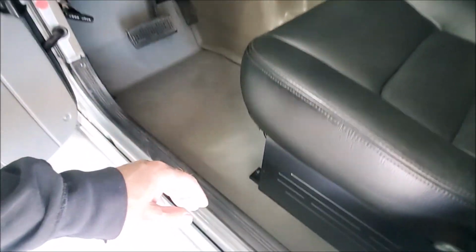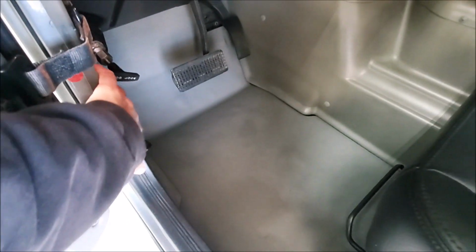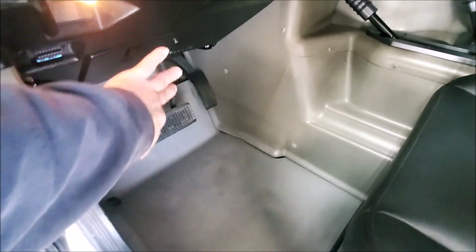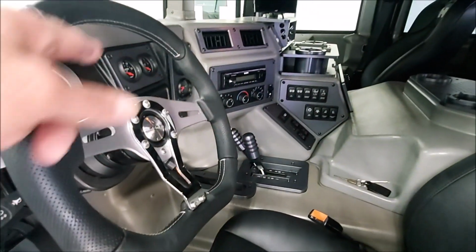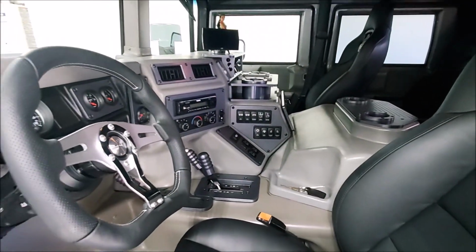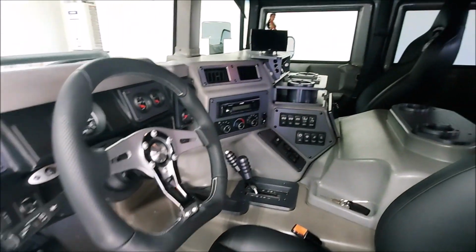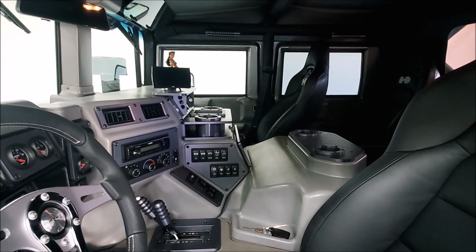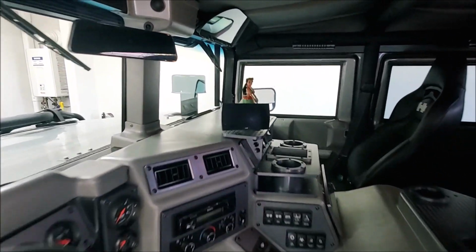And these panels come out really easy. It just takes time to get it out, fish everything out. And the plastic panel here, you got to take out your footwell panel here. You got to drop your closeout panel. Then you got to run that wire behind the doghouse and get it out over to where you're going to make your connections. So everything's done. Obviously my fuse is back in for my dome lights, so they're all working again. And what do you say we road test this thing and see what it actually looks like?